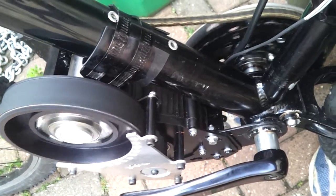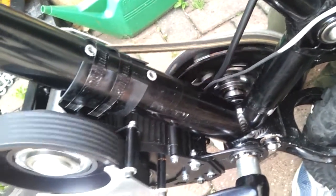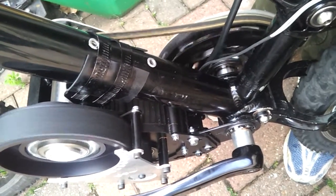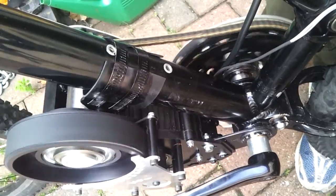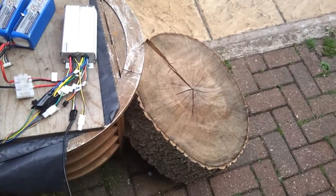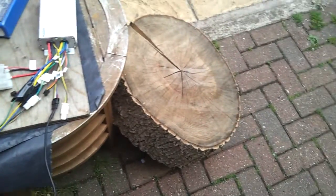But I've wired it up and it runs — the motor's moving and it spins up nicely. That's at 48 volts; there is an option to step that up to 72, the controller will take it — 72 volts at 35 amps again. I'm right on the edge of my motor's capabilities there, though.